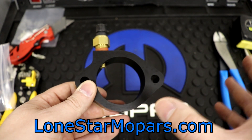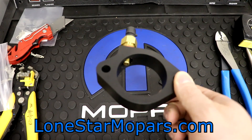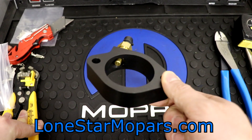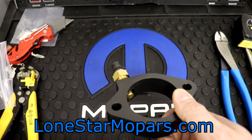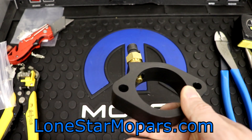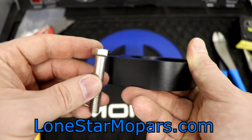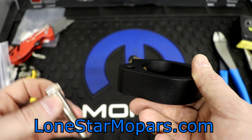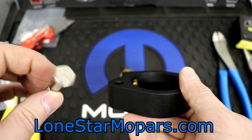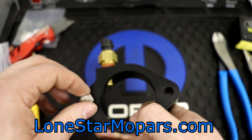This is something I'm going to use on the Duster — can't wait to get it in. On the Charger, I'm going to bring one in. If you're a guy that installs them or helps your buddies or car club members make these conversions, this is something you're going to tell every single one of them — buy that, it's going to save us time. Now typically, if I remember correctly, 3/8-16 thread is what we need for the bolts. I go stainless 3/8-16 by 2-inch. Since it's a 1-inch spacer I wanted 1 extra inch of bolt — you could probably get by with 1.5 or 1.75 inch. I haven't gotten to install this yet, but when we do the installation video I'll figure it all out. I'd prefer a socket cap screw as opposed to the traditional bolt, but for the time being it will work. And I've got to say, with that black anodized finish, that stainless pops quite nicely.